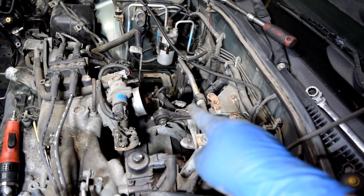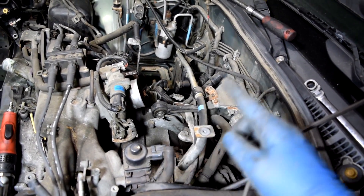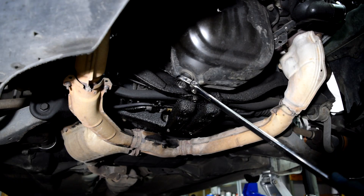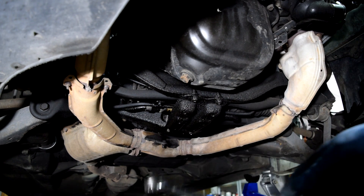I'm actually going to leave the other 2 bolts that are on top for last and then switch underneath the car and remove all the bell housing bolts underneath, remove our exhaust manifold bolts and our motor mount bolts. Actually, before I forget I'm going to drain the engine oil, and I guess we might see some metal shavings in this.